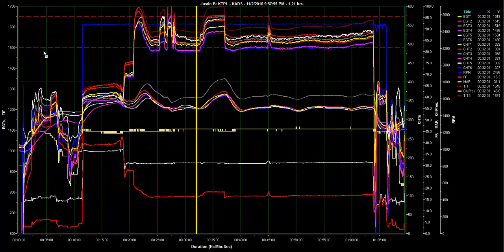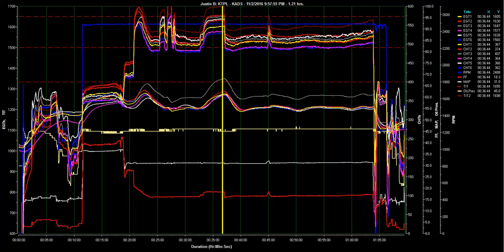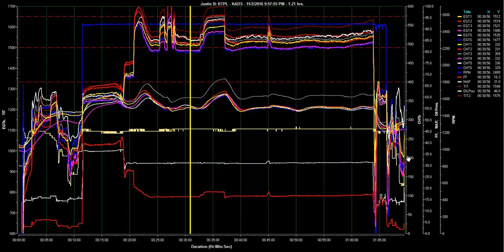Let's take a look at the rest of the chart. Back here on number five, we see number three of course goes up to 407, maybe actually a little higher — 408. As we did a calibration test, you found out that your manifold pressure is reading higher than actual by almost a half an inch. That means 30 and a half inches is actually 30 inches of manifold pressure. And you're putting your fuel flow in to try to match 30 and a half inches, but you're really only putting in 30 inches. So you're actually on the rich side of where you want to be according to the POH.